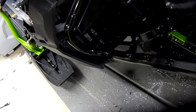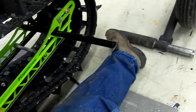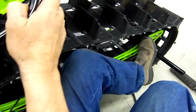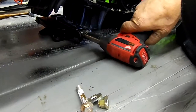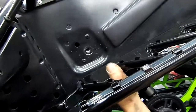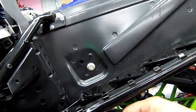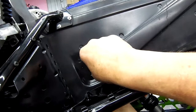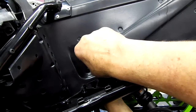that we started, we're going to take a shorter flange head rivet and we're going to rivet the one that we removed earlier in the process. We take one of the running board ends that you just took off, put it through the chassis rear skid so you can use it for leverage to put your foot against it, and then what we use is a real simple jack, scissors jack, and we just take this until the hole lines up like this, install the bolt, the washer and the nut, and just lightly start the nut so that we're going to tighten it after we have all the bolts installed in here.